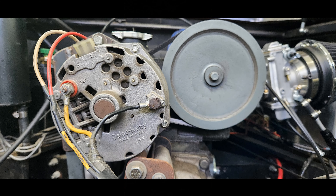I was able to find a US-made Delco Remy alternator that was just about the same size as the English one. The key thing is that the US one had a built-in voltage regulator, so I didn't need to use that Motorola device at all. I was able to bolt it on, though I had to make a special adjustment arm because it didn't fit exactly the same way that the other one did.